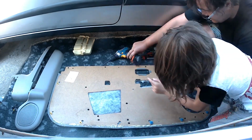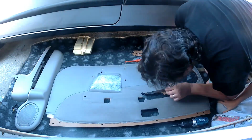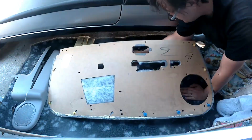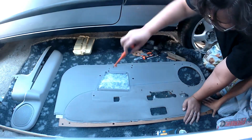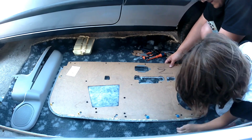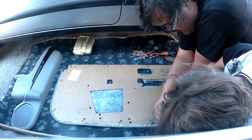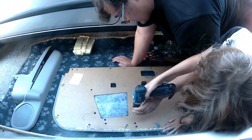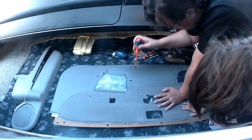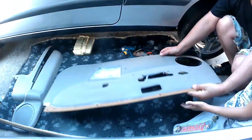So what I actually did, or in this case my son actually, who came to help, we drilled just into the cardboard itself, and then we went behind where we drilled into the cardboard and got rid of any screwed up or furred up weird material, just to make sure it was clear. Then using the screwdriver, we felt on the other side where we drilled, in the proximate area, and once you felt a definite dip which coincided with the point that you drilled through on the back, you can then just use a standard screwdriver to pierce through.